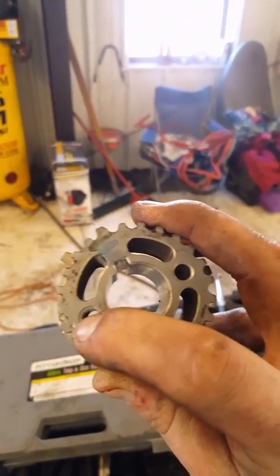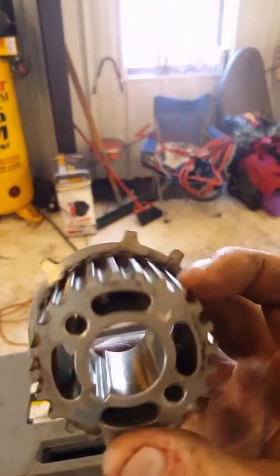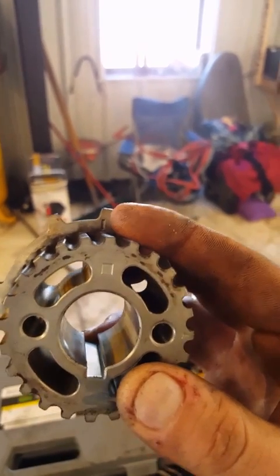This right here is not your timing mark that you use to line things up with. You actually have a line — right there — so you're going to want to use that notch to do your timing.